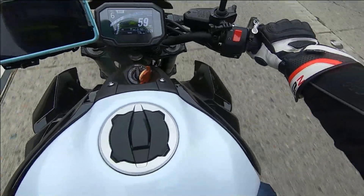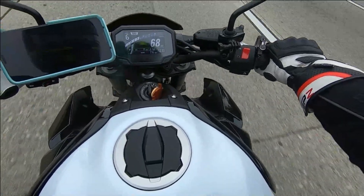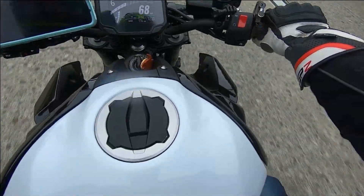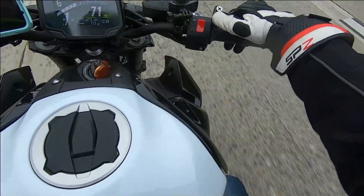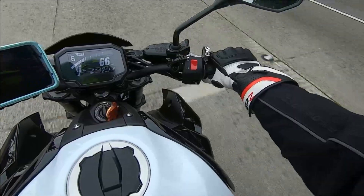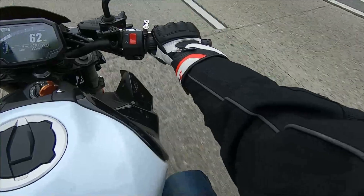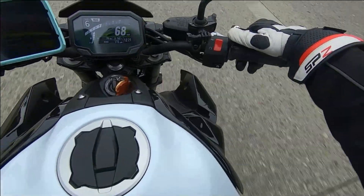The way it works: I disengage it by pressing the X — that'll put your throttle back. And then the bottom button is where you want to engage it. That'll lock your speed. So while it's in lock position, you can still adjust the throttle, because if you're on an incline you'll lose speed, and going downhill you'll gain speed.